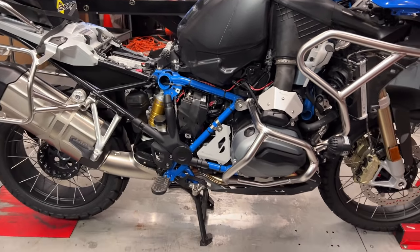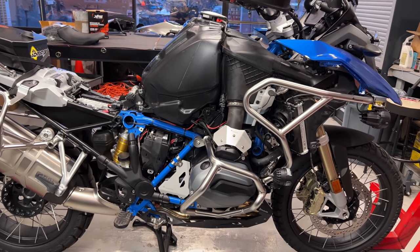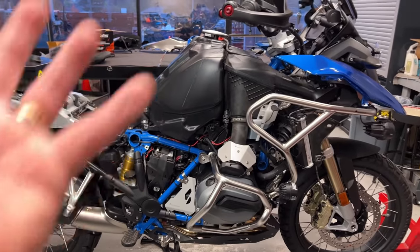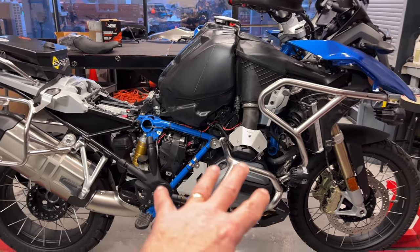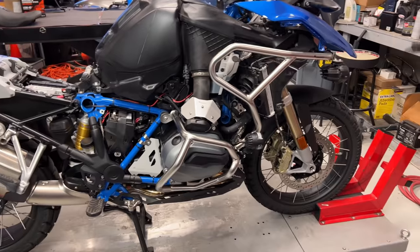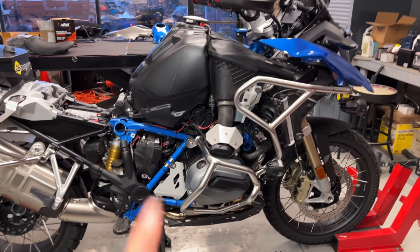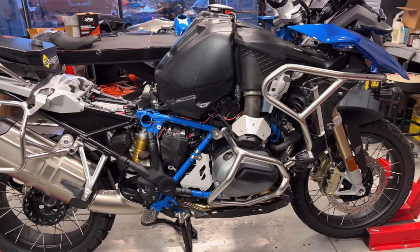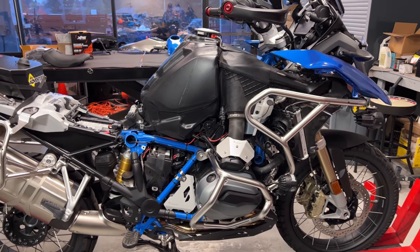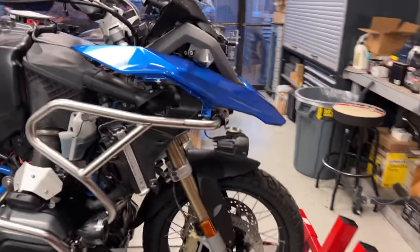It's just easy. I just tell customers, make sure you go 10 miles. It's a big motor. It takes a bit to heat them up. And well, it's not the heating up. They heat up fairly quick, but it takes that long to burn all the moisture content that's created in the engine. And on the BMWs, it vents right back in and circulates through the engine so it doesn't go out in the environment. Now, what you do after you purchase one of these things, if you want to eliminate something like that, you can, but still, you need to get all that condensation out of the motor, all of it. Oils are really, really good nowadays, but I don't want any moisture in my motor. You can do what you want. And if you don't work on your own stuff, that could be quite costly to you.